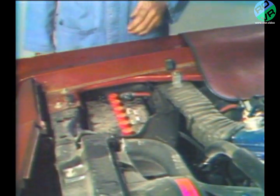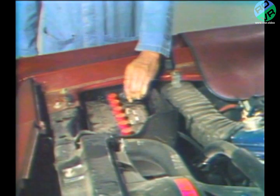Some owners experience trouble with their electrical power supply system because of such minor things as an automatic trunk light that stays on all the time, even when the trunk lid is closed. Such cases of battery drain can be difficult to locate and are often the real causes of unnecessary replacement of alternators, regulators, and batteries.